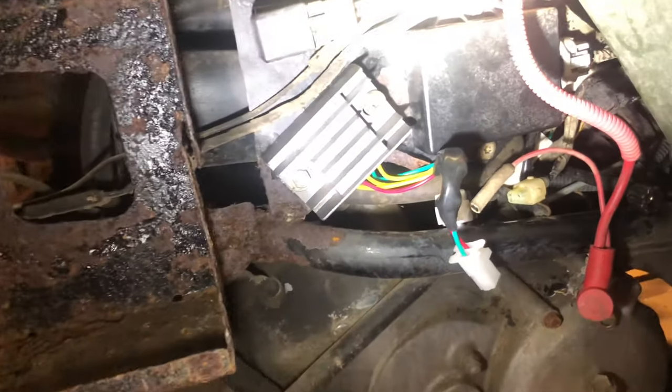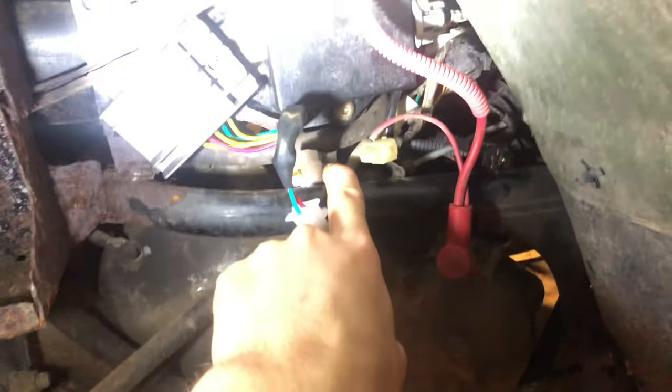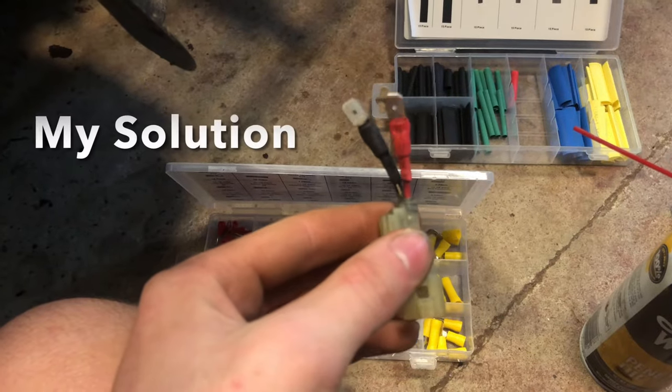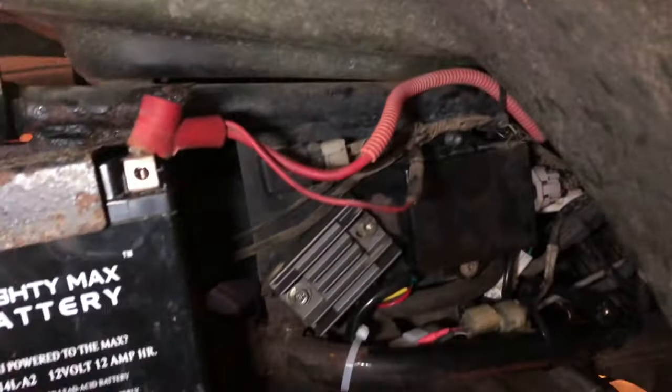All right, so the voltage regulator's in there. The wire going to the stator, that plugs in perfect. The wire going to the ignition, the CDI, and the battery, the wiring is not going to be a direct plug-in. Boom! Everything's wired up, plugged in, and ready to drive.